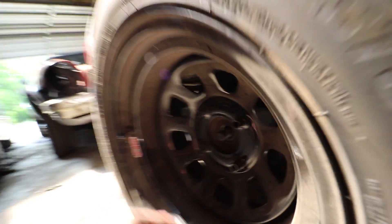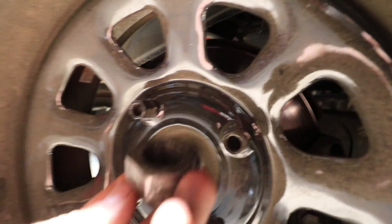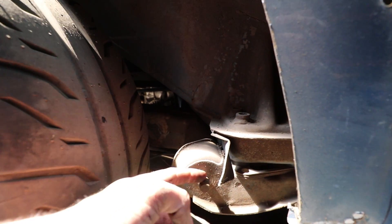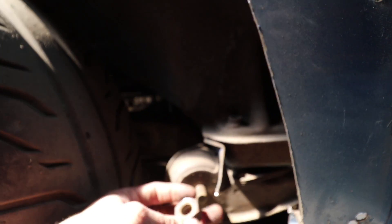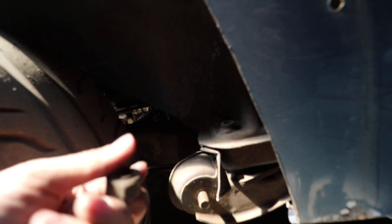So let's go stop by the shop, pull off one of those CV axle nuts, pull off that other nut for the trailing arm, and then head to the hardware store to see what we can find. Pulled the fender off so the car looks like a Mad Max off-road mobile. Just pulled off the center nut and as you can tell there's supposed to be a washer in there which I don't have, and then I pulled off this nut because it's the same size — the one that's missing is on the inside — but just gotta go find a nut for these threads, hopefully should be available somewhere.